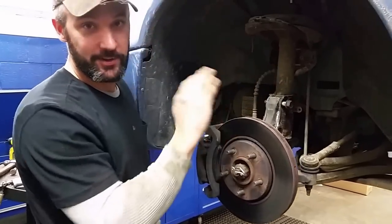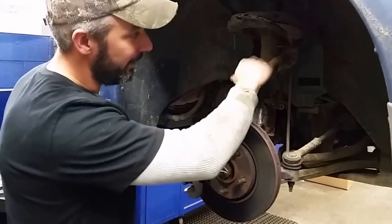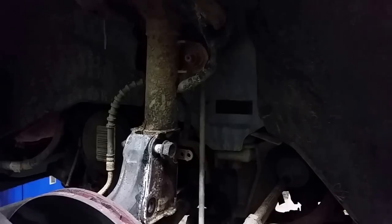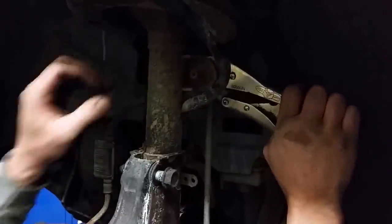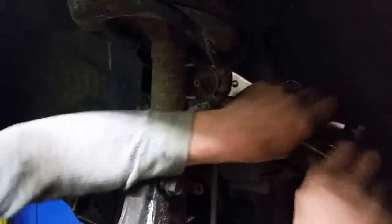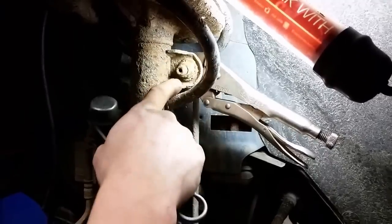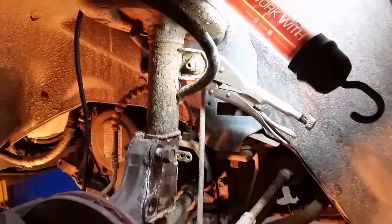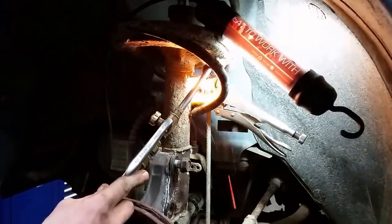Like I said, this is New York — we have a lot of salt, so this is rusty. In a perfect world, in the middle of that sway bar link there typically would be a spot where you could stick an Allen socket or a Torx bit and hold it while you back this nut off. But that's in a perfect world. So here, right behind that sway bar link, there's a metal flat on it. You can get a hold of that with a pair of vice grips. Go ahead and just clamp on that with vice grips. Now that you've got your vice grips snapped on there good, just know from experience that when you back that nut off, it's going to lock up on that sway bar link. We're going to use a torch and heat the nut up a little bit, just to get the nylon to burn out of it.